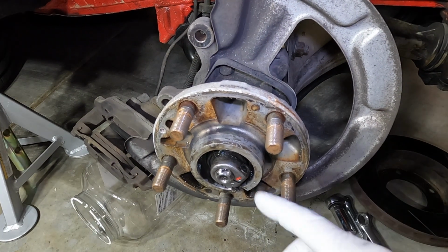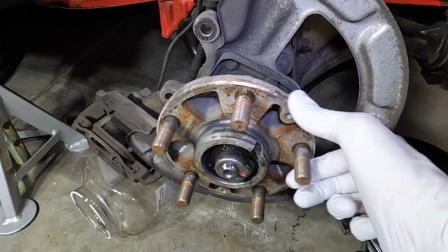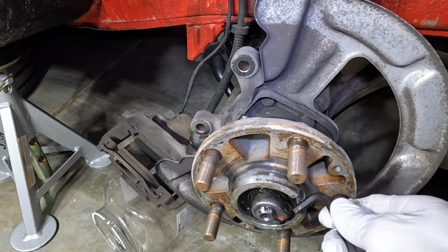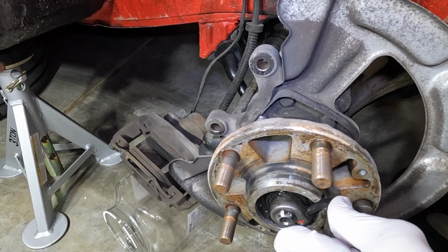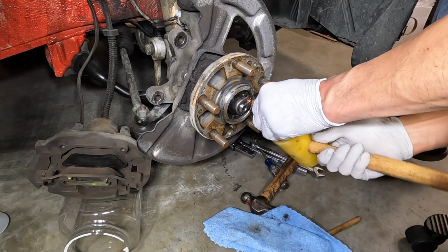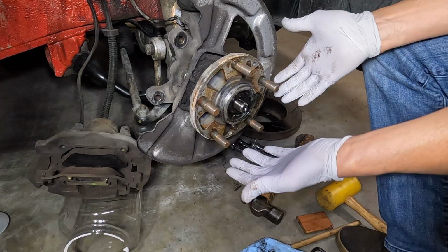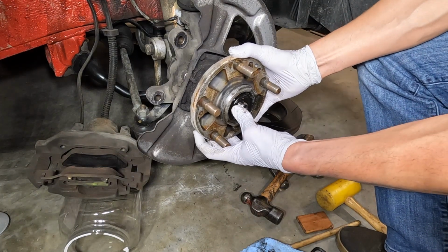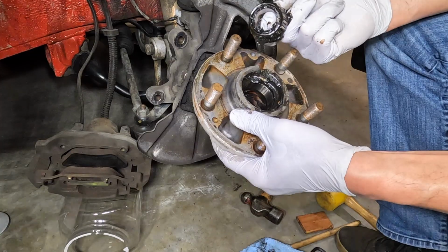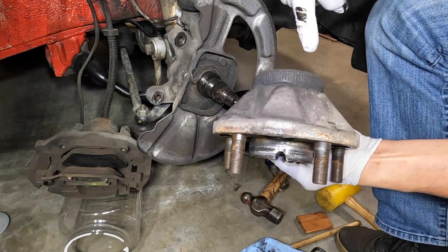Okay, next to remove, there's a nut. That's a nut, I'm going to say, with a collar, and there's a little slot here for an Allen wrench, and this is a 6 mil Allen wrench, and you loosen it. Okay, and then it should just come out. So there's a keyed washer right there, and then these bearings. And then so I'm going to clean all this up.